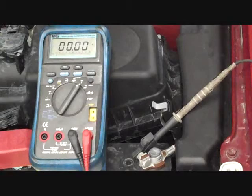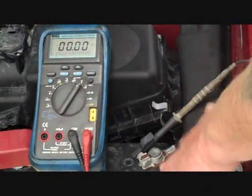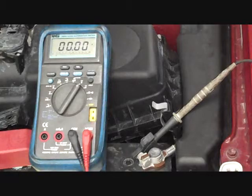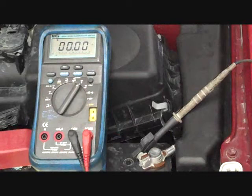If there's any weaknesses between the starter circuit ground, the engine ground itself, and the battery negative ground, then I'll need to isolate the circuit further to determine exactly where that cause is. So let's crank the engine and set the meter on record, since it's just me, and let's see what the voltage drop is.